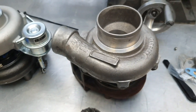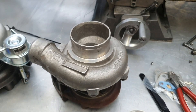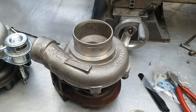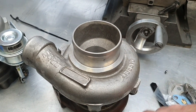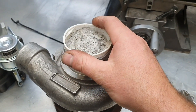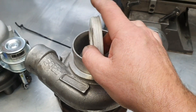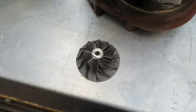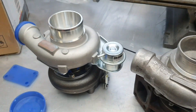I won't put it in the good one. So this exact turbocharger - strangely enough this one won't fit in here nicely but it did fit when it was in the car. Then I modified the intake system, slipped the intake system over the top, thought 'that's awesome', must have had a phone call or went off to lunch, came back, did not take the intake system back off and double check everything. Simply slipped the clamp over the outside and did it up, leaving that in there. First time I put the foot down it cleared - sucked it in. No excuses, but we're upgrading.